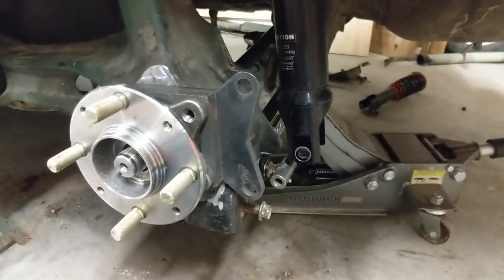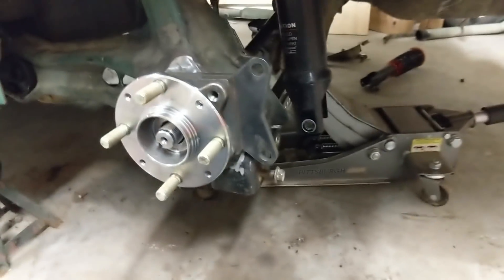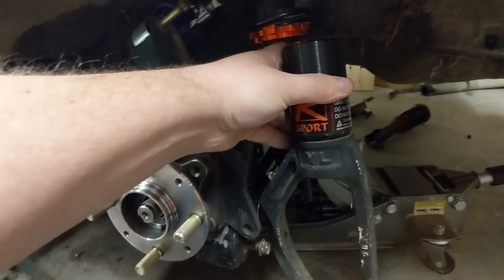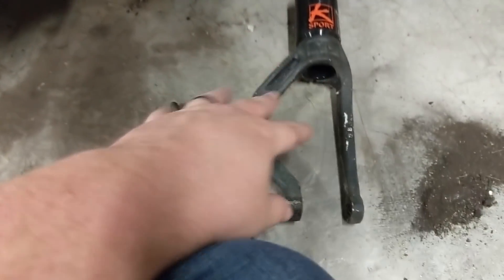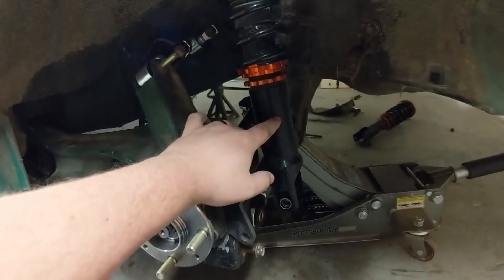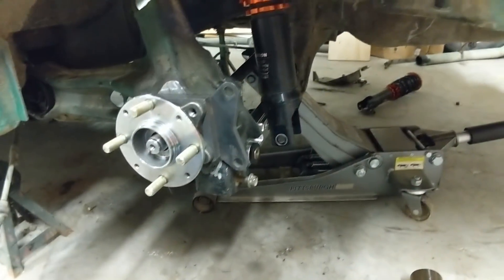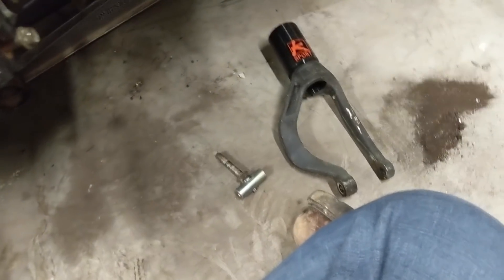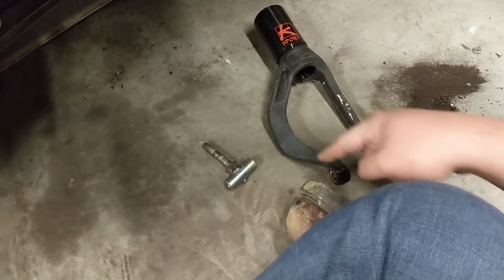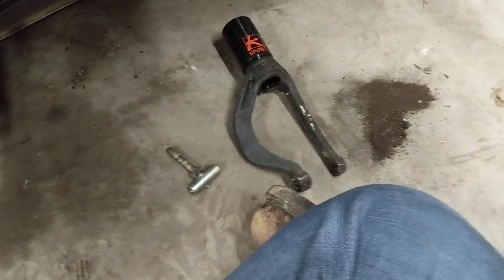The next option — which I'm not really going to demonstrate fully — is putting one of the front forks on the back. If you modify the fork to have a very wide opening it would probably work, but I didn't want to have to order new bottoms for my coilovers and I'd have to lower the coilover all the way. You could experiment with MPC forks, but it would need to be much wider, so I don't think it would work even with MPC ones.